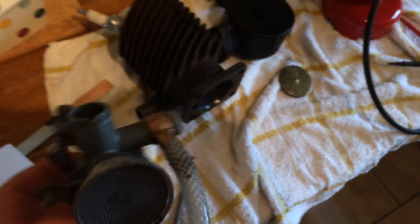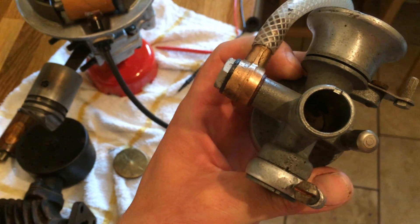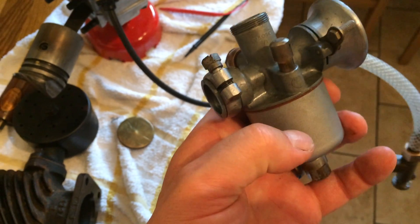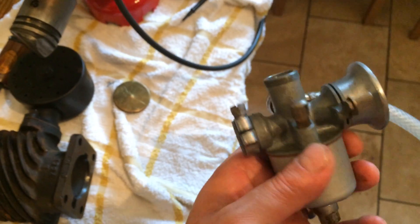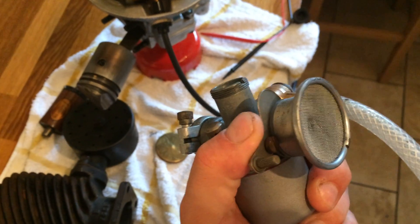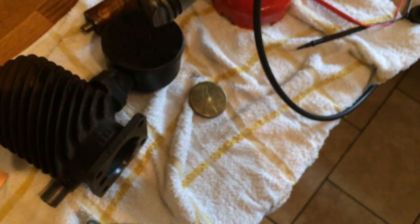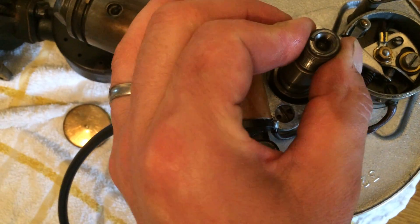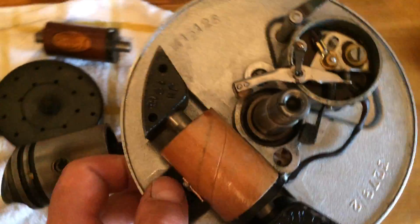Here's the carburettor. I love these little engines — they're so simple and robust. Look at that carburettor: it's got virtually no moving parts. You've got the sliding throttle, a tickler, the needle, the float — that's what operates the throttle. It's got a simple air filter like a tea strainer, and that's the choke — it's like a little flap that strangles off the air. The main bearings are just brass bushes and I couldn't get any significant movement on either end.